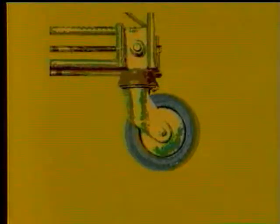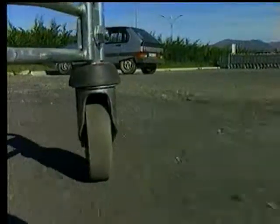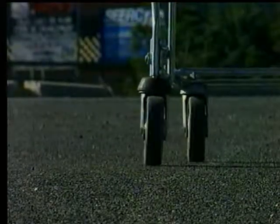With a certain amount of trail, the wheel contacts the ground behind the steering axis line — meaning it is being pulled — so if deflected by a bump, it will return to straight ahead on its own. The rake angle contributes together with trail to machine stability. This is similar to the shopping cart wheel which, despite having trail, oscillates constantly around the steering axis due to the absence of a rake angle.